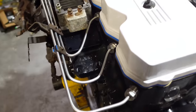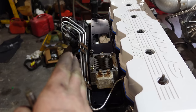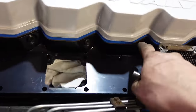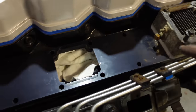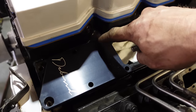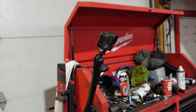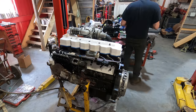There is no easy way to do this — it is just trial and error. I started with the one at the farthest back. I would have liked it completely parallel to the block, but the line just wasn't long enough. These were 32-inch lines. I could have got 34s, which would have worked for that line, but then you start getting into issues bending it around the intake. I'll probably stack them in two rows of three. This line basically has to go around the intake, go this way, then come back and up to that injector. We'll keep going — got the time-lapse going and we'll play some nice music over it.